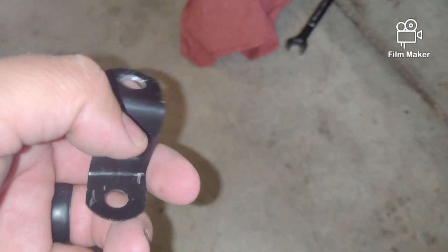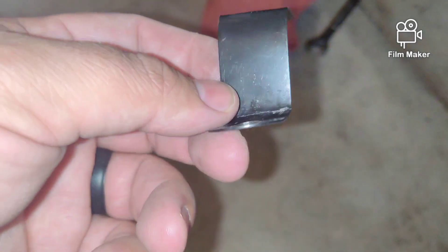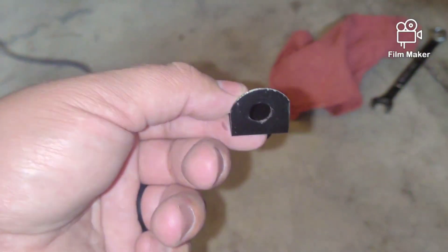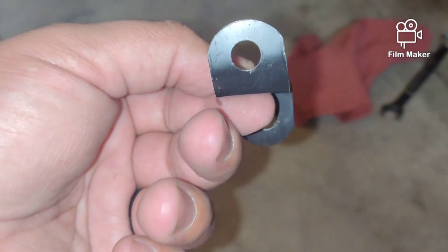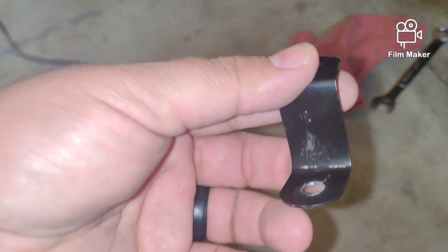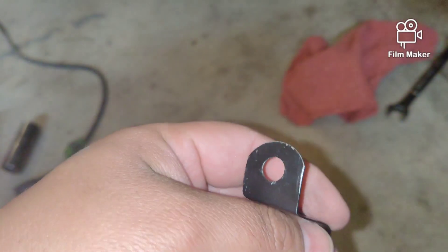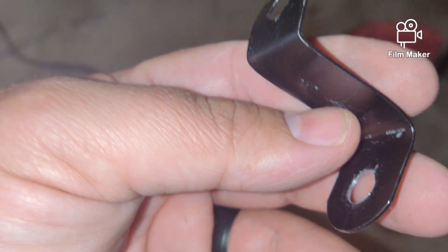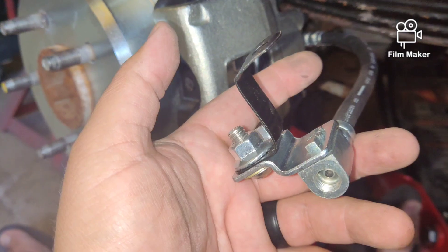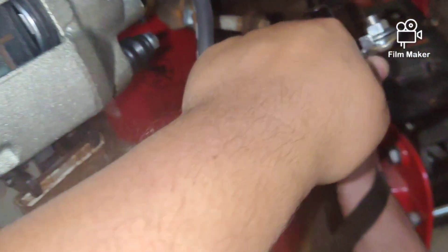I have a problem where I like to overthink things. Instead of cutting, re-drilling, and doing all kinds of extra work, I just took the bracket and bent it to like an S-curve or Z-curve — one side bolts to the axle where the stud is, and the other bolts to the brake line. Found some leftover bolts and nuts I had lying around, and then we can manipulate this, bend it up for clearance, and make life easy. The bracket is bolted to the brake line and we'll just swing it under and hook it to that stud.